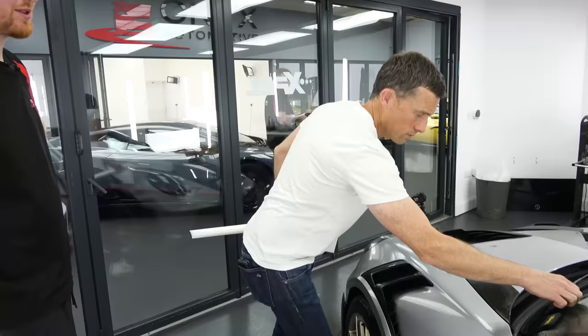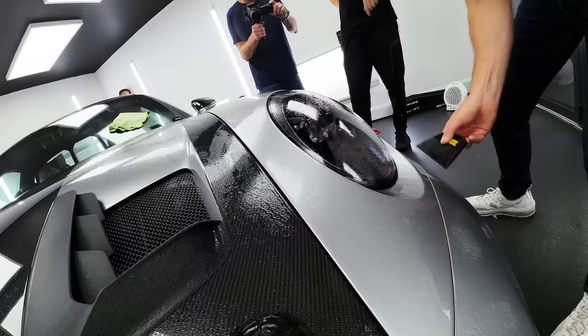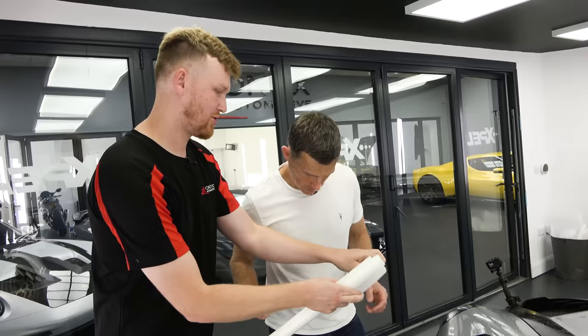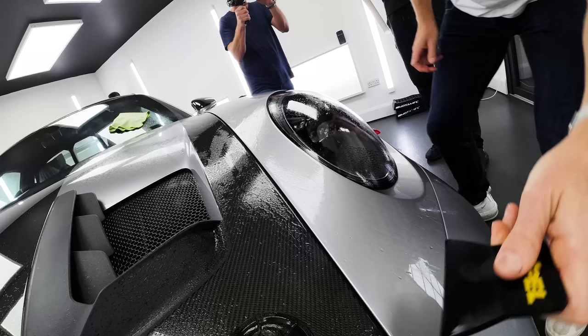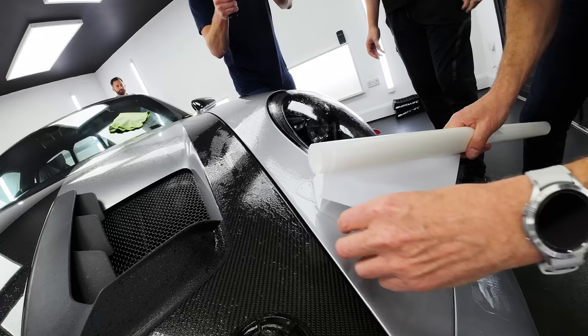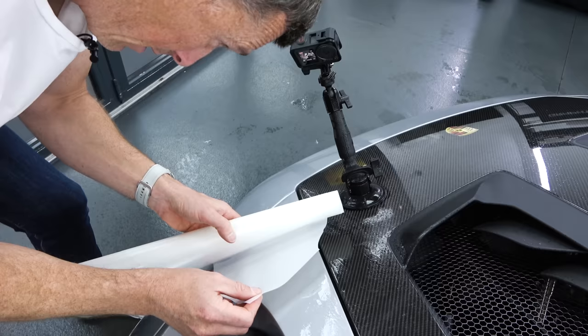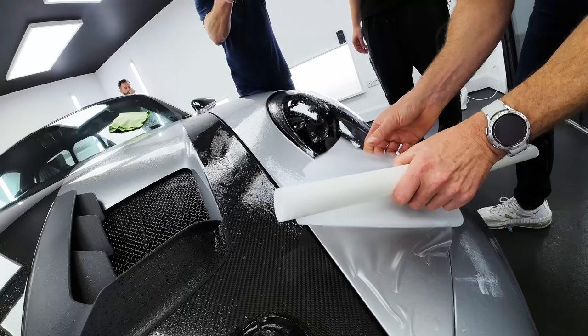We're at three minutes so let's continue the clock rolling. What do I do? We need to slip up the whole panel first - cover the whole panel in slip solution. You want it nice and slippery, you don't want it sticking to itself like before and ending up in the bin again. Now wipe the bottom tenth of the panel, all the way across and around under the headlight. Now we're going to start - you pull the backing paper back nice and slowly with the right hand while holding the film with the left hand. Something's happening now - I'm liking this.